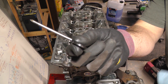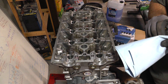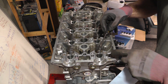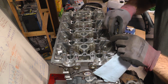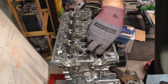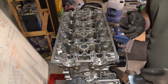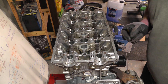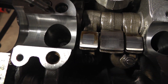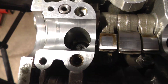The first thing we need to do is drop these little washers down. Make sure they're clean with nothing on them. I'm going to use a screwdriver — place the point of the screwdriver on the head over the Allen stud — and just drop the washer down that way, so you don't have to play some kind of circus game getting it over. You can see the washer sitting down there where it needs to be.